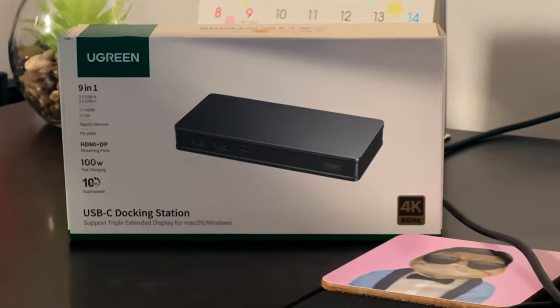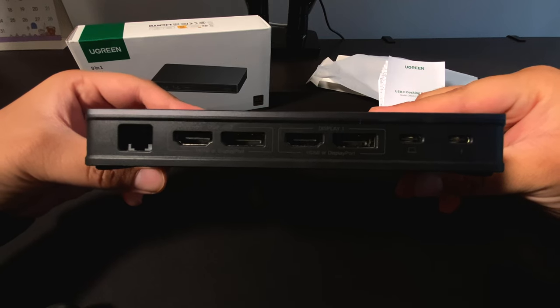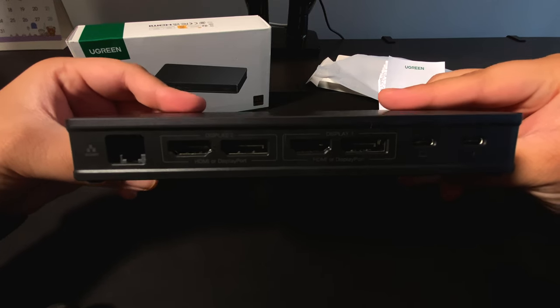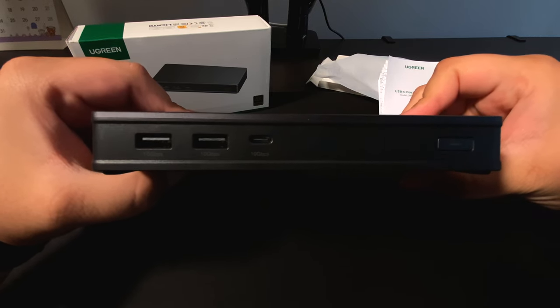Well, this is it — well, this is the box. I'm using it right now so I can't show you; I'll show you in B-roll. This is the Ugreen Revo Dock Pro USB-C docking station, nine-in-one with DisplayLink. That's a mouthful. The nine-in-one refers to nine ports: Ethernet, display out one, display out two, power delivery, USB-A, USB-A, and a single USB-C. Wait — that's only seven. It seems that Ugreen counts each HDMI and DisplayPort as a separate expansion, which is weird because you can't have four external monitors. So just be aware of that.